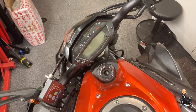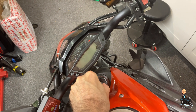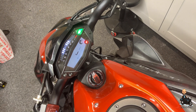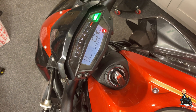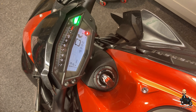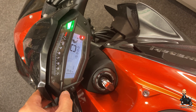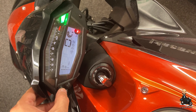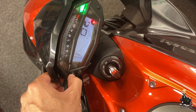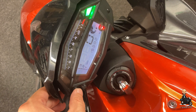So I'll show you that first just on the bike — it's quite neat that you can do this. All you need is your bike and your key. Pop the key in and turn it on. Now if you've got a problem at this point you would have an engine management light come on and it would also be saying FI on the screen. What you do is press your selector button, your function selector, until you get to your odometer — there you go, 15,000 miles.